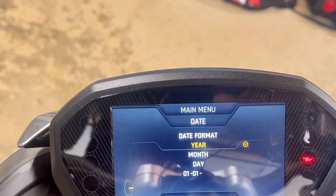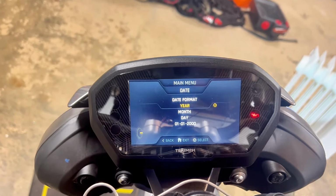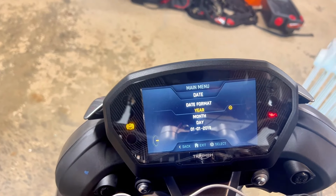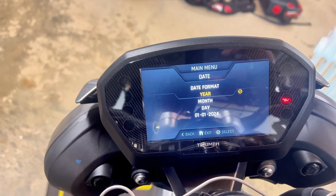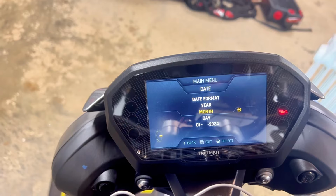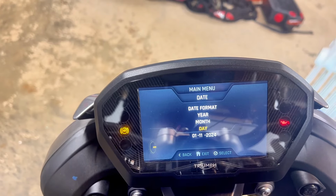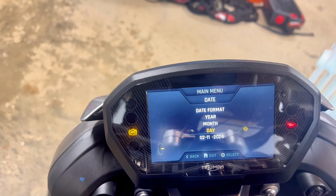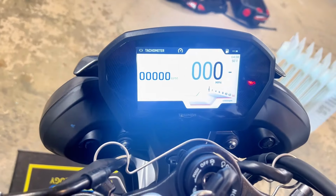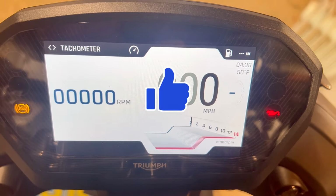We'll scroll down from there to the date. We'll go to year, and we'll select that, and then we'll press up and get to the current year, 2024. And then we'll scroll down to the month. We'll correct that. We are in November. And we'll go down to the day. Today is the 29th. All right. And you see the check engine light or the wrench is no longer there.